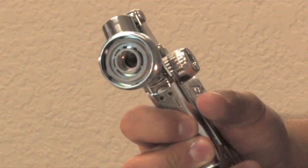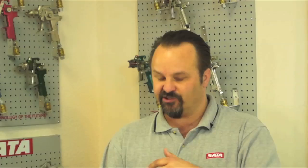When we get damage in behind the fluid tip because they're using the wrong tools to clean it, it doesn't seat up well with the air distribution ring in behind that fluid tip, and as that happens we start getting leakage of air and fluid back and forth in between the passages. All of that causes a disturbance which may be a fluttering fan, it may be blotching, it could be fan shape issues — all of that stuff is directly related to gun maintenance.